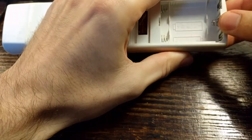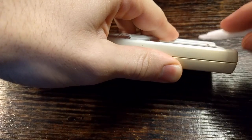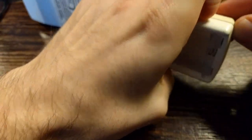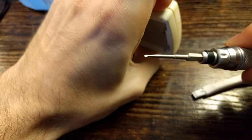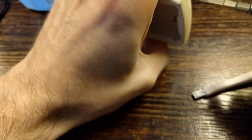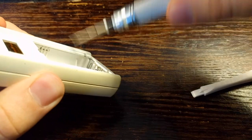You should be able to do this without really damaging the cosmetics of the remote. What you want to do is take the battery cover off so that you can apply leverage from the inside. If you do chip away at something, it's not easily identifiable or it doesn't matter as much. To start, you're going to want to work on the bottom. Use a pry bar like this in addition to a really small flathead screwdriver — two flathead screwdrivers would also work. I would recommend working from the inside when you do this.